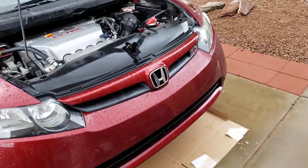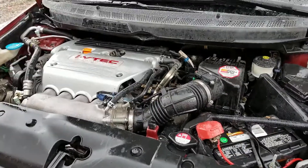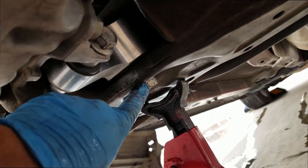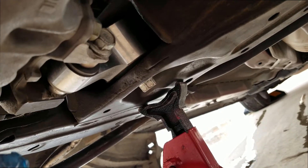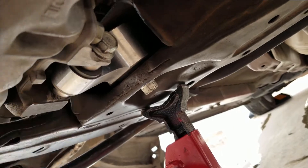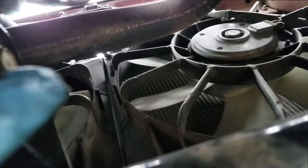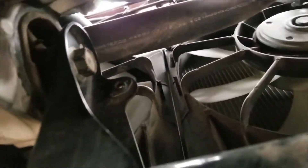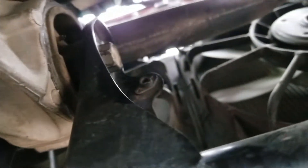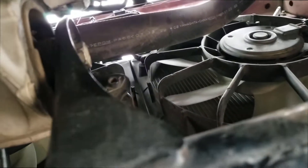It's raining over here so I got to work in between that. Down at the bottom there are two bolts — you take either this one or this one off so the engine can rock back and forth. Over here is your front mount; take this bolt off right here. When we take those off the engine will just be hanging by the two side mounts and we'll be able to rock the motor back and forth. That clutch should just drop right out.